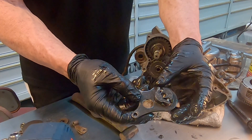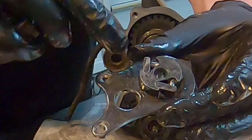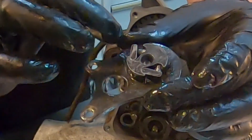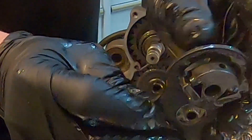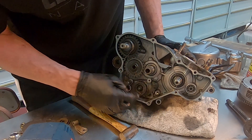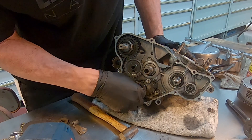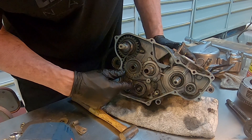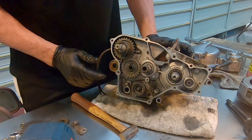That's the way they should look. The pawls are on the inside and the most radius edge is the one that inserts into this drum, and the sharper edges are on the outside. They have a relief on the inside where the pawls slide — you can see that kind of right there. This is basically the part that has to do with gear selecting, and you've got to get this little spindle piece out, which has a hex on there and there's a pin on the back side. You just don't want to lose track of that pin.